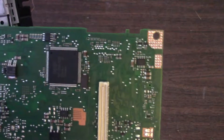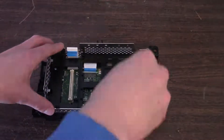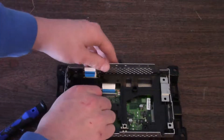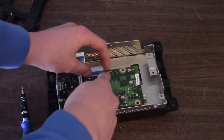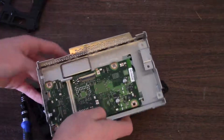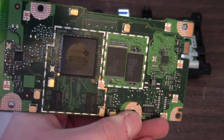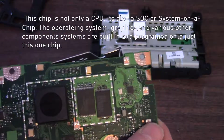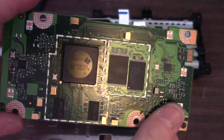There's not much on the other side besides that one controller. Now in here we have a plastic frame and another board under it. This black piece of plastic just pops up — there are some snaps holding it in and it just comes out. Now I'm going to undo these ribbon connectors and separate this piece from this piece. In here we can see the board. On here you can see there are some memory chips and the main processor. This processor would be processing all the data that goes through this unit. This chip would also have the graphics and navigation interface programmed on to it, so it would be doing most of the computing in this unit.